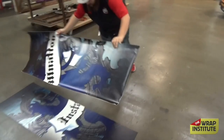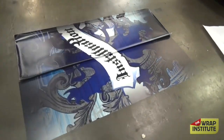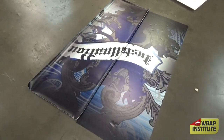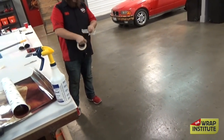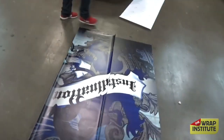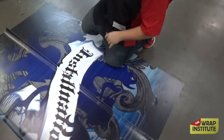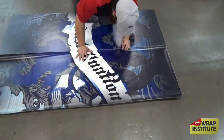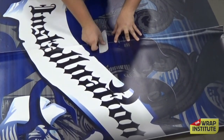Registering floor panels is always a little tricky because of body position. He lays the panel down, and similar to what you do on a van in the RapidSuit series to register panels, it's the triple hinge. He's using masking tape — he cannot use magnets here because it's a concrete floor. He uses extra-wide masking tape because it has extra holding power. He registers one piece, lines it up, and uses the overlap as a guide to get the panel set up.